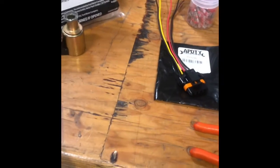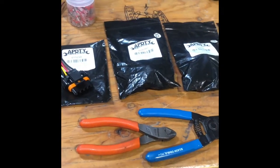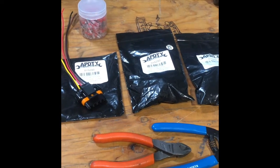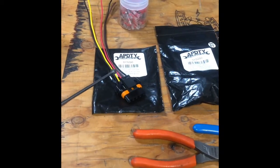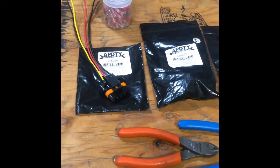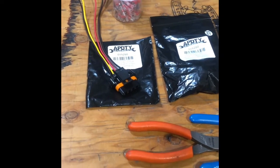Back from lunch, we're gonna get to work on the OBS Ford. I got some injector harnesses on the 7.3 liter Power Stroke that are a little bit dry rotted — they're starting to split right at the bottom. Whenever you got a split you're bound to get corrosion in there. Corrosion ends up creating resistance in the wires and then you're not getting the right signal.